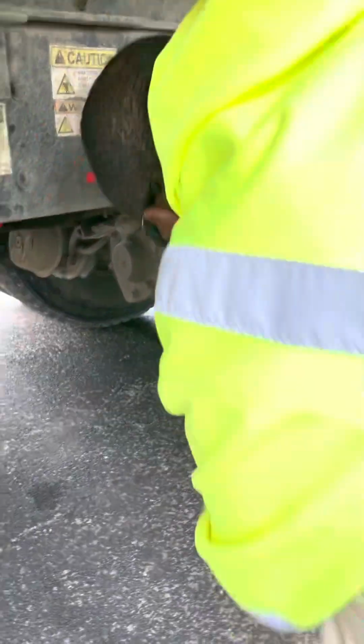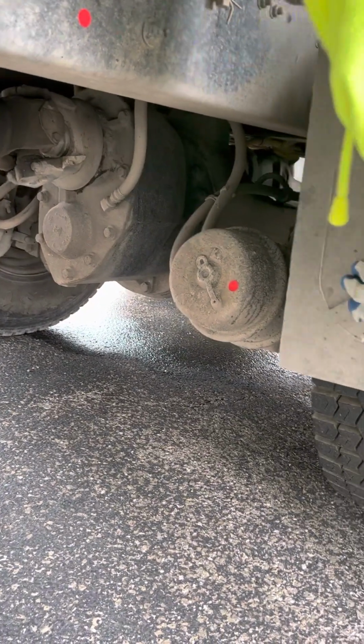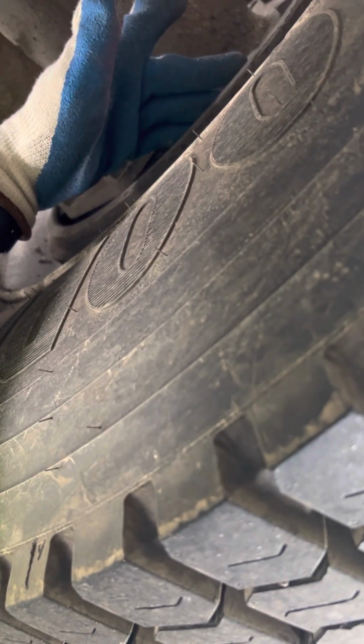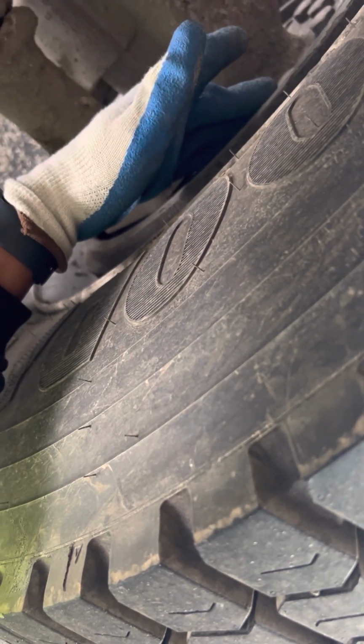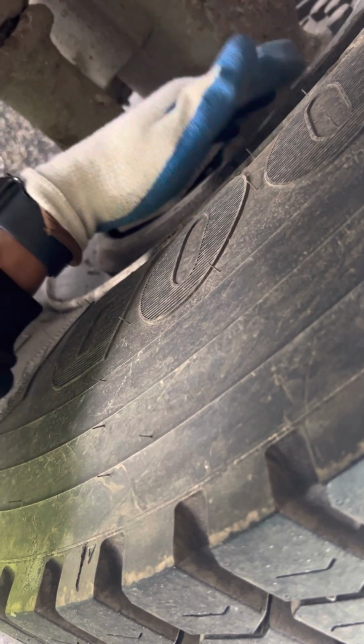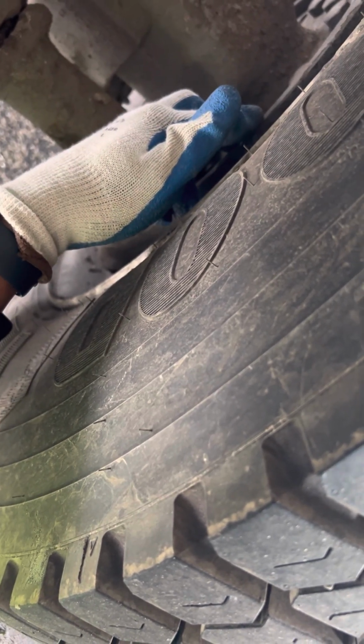And let's see here. All right, I'll finish up on the inside of here. I got my brake linings or pads. Make sure that they're not bent, broken, or cracked, properly mounted and secured, with no heat stress, no fluid on them, and not worn dangerously thin. Then I have my brake drums on the outside, no fluid on them, no heat stress, not bent, broken, or cracked, properly mounted and secured.